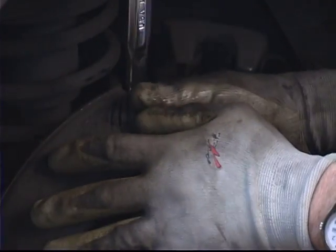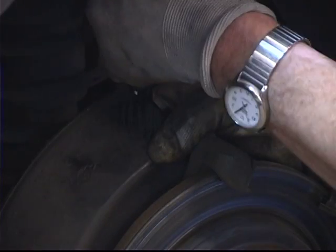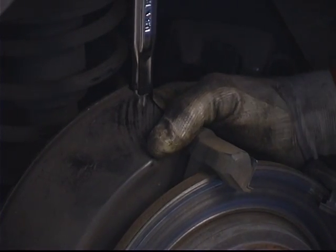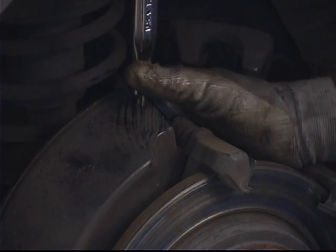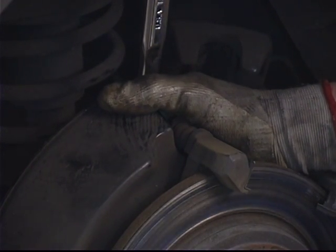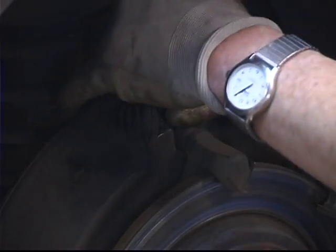When I did so, I positioned my body back from the car, because when I yank with that hard amount of force, if it should happen to move the car or cause it to slide off the jack stands, my body is set aside from the vehicle. So if it should go down, I'll have adequate clearance and not be in the path of injury.